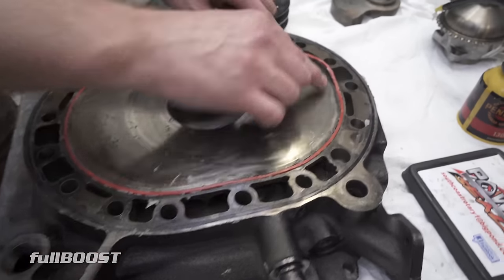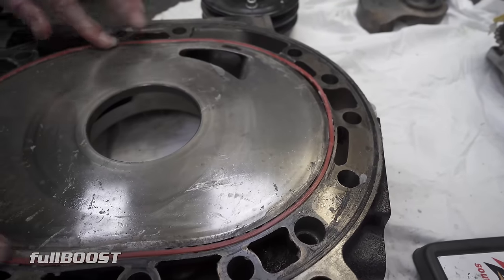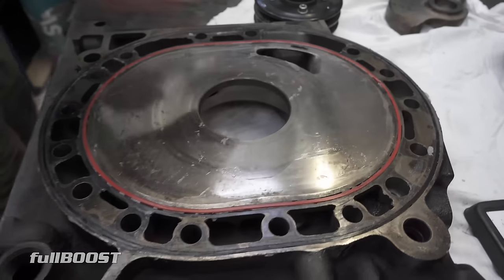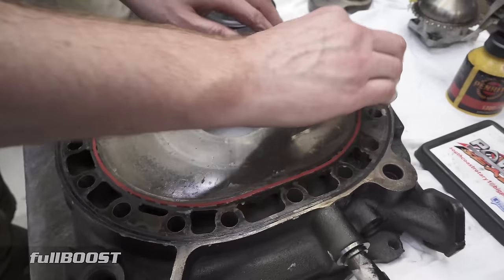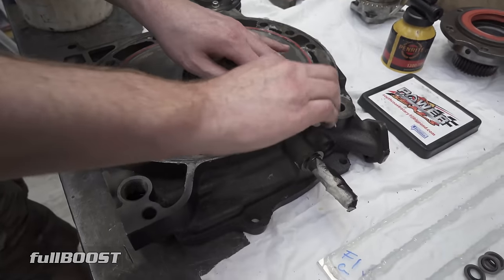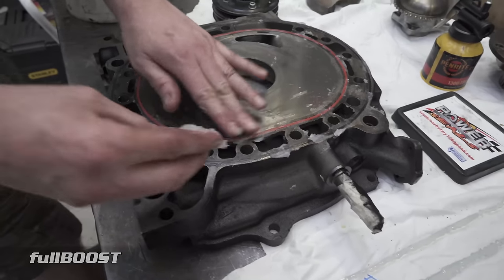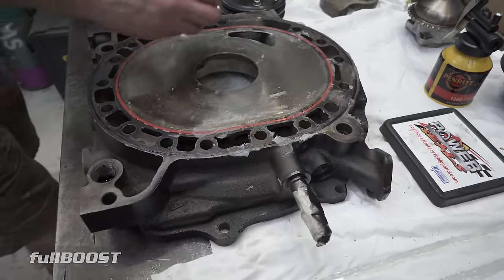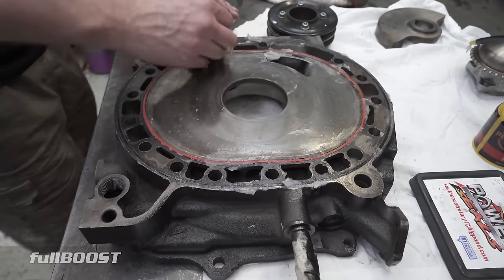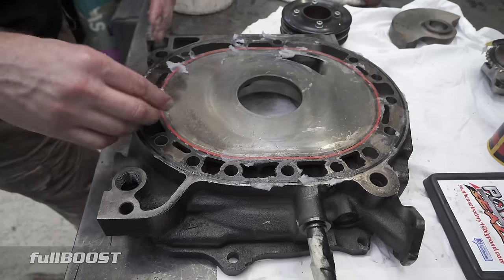You can see there's obviously a bit of seal overlapping, so all you do is push the seal, bunch it up a bit around, and you'll find it just drops into place. What I'm going to do now is put a bit of extra Vaseline on here because it is hot. The worst outcome is dropping the engine in place and the seal falling out of position — if you do pinch a seal, depending on whereabouts it is, if it's external you'll get a water leak. You don't need to fit the stationary gear now, but I'm going to anyway.